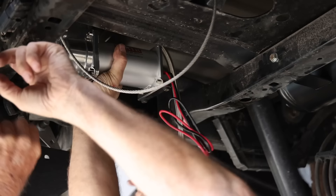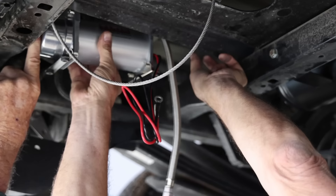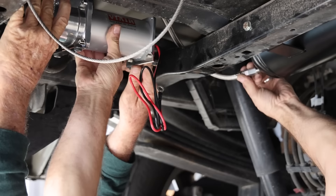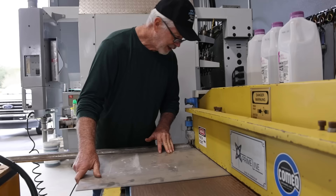You need two pieces of angle iron — 20 and a quarter inches each. The angle iron goes on the outside using self-tapping screws, and that didn't affect anything with the tire. We have to make sure it's angled or moved forward enough so we can get the hose into that port.